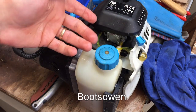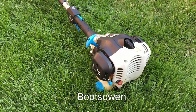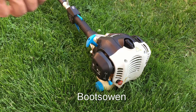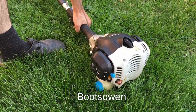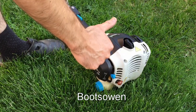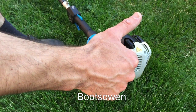So almost a no-tool fix. But let's test it first before we proclaim that it's working. I've replaced the fuel line. I've replaced the fuel as well — it was looking a bit old. The two-stroke that I've put in has a red color to it; the stuff that was in there was a kind of honey-yellow color, a bit weird. So let's try — six primes on this one, choke on. Thanks for watching, see you later.